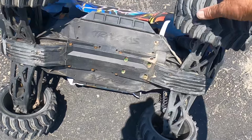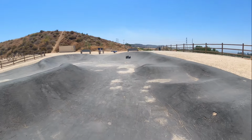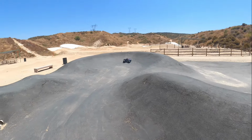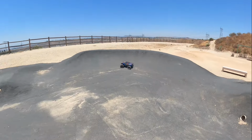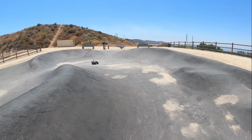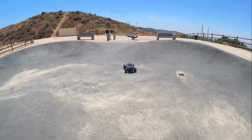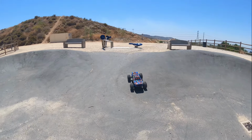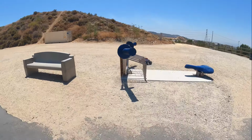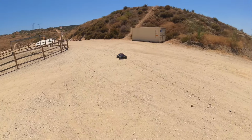So there's the green washers for the motor. It's one thing I do recommend is to run your pins. Don't eliminate them, even though Traxxas says you can. On hard crashes, you will move that motor and the mesh will get tight, even with the washers. So I run the pins, and you're able to pry and get the mesh correct. Just don't rely on the pins. You'll still have to put a screwdriver or something in there and push the motor to get your shimming proper.